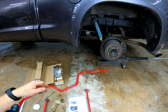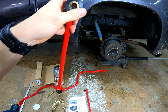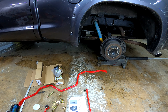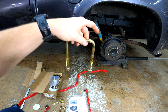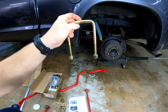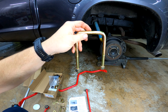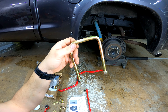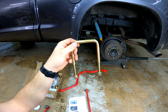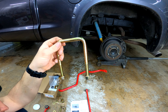Once that's done on both sides, these links are going to hold your sway bar up. Then you can rock or rotate the bar to the axle. Starting on either side, you slide both U-bolts on top of the rear axle and drop them down over the axle. The left-hand U-bolt should be on the outside of the brake bracket, and the right-hand side should be on the inside of the brake bracket. Ensure that the speed sensor wire and brake lines don't get clamped.